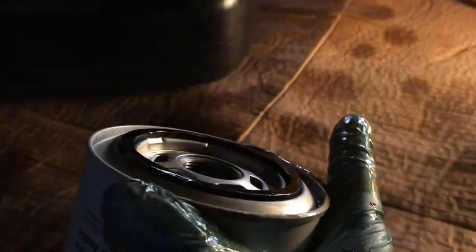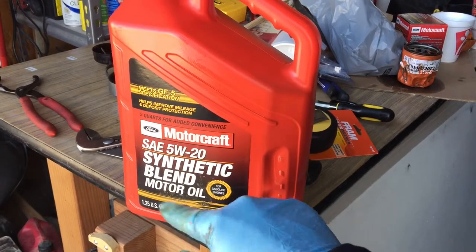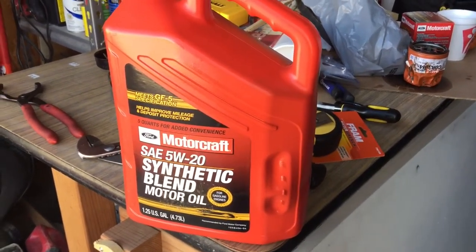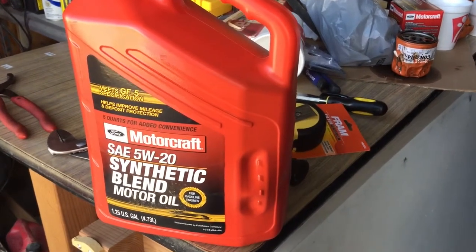I'm going to get plenty of oil on my finger and rub it around that rim where it's nice and shiny. That'll make it a little bit easier to pull off next time. It's also important to check your block to make sure there's nothing left over from the last oil filter — and I can see there is not anything left over on mine. Now I'm going to pour a little bit of oil in here because I like to prime it, and then I'll screw it on up there. I'm using Motorcraft 5W-20 synthetic blend because that is what my engine calls for — Ford specifically makes the Motorcraft brand and this is what they recommend for my vehicle.